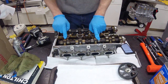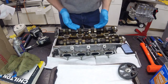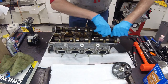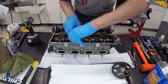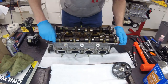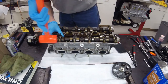All the caps also have arrows pointing toward the front of the engine for reinstallation. The removal procedure is bolts 1 through 10, then copy that to the exhaust cam. Once all your bolts have been untorqued, just loosen the bolts from the caps. I leave them in the caps so they stay in their original position, and then you'll need to take a mallet and knock the caps loose.